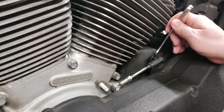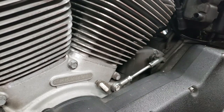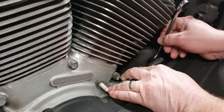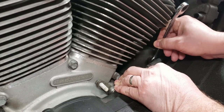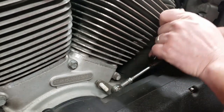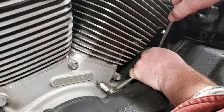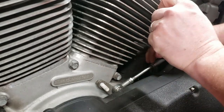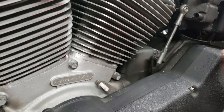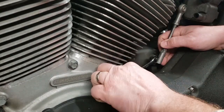Now we've got that out of the way, we're going to go to the back here. It's held in place by the shifter — it just threads right into the shifter rod out of the transmission. We're going to take the 7/16ths wrench here, put it on the nut. There's not a ton of clearance in here for wrenches, but there never is working on motorcycles. We pushed our knuckles there a little bit, and it popped free. Let's see if we can spin this up out of the way. There we go, and we are turning.